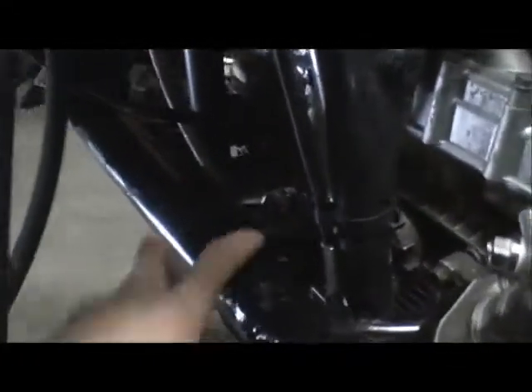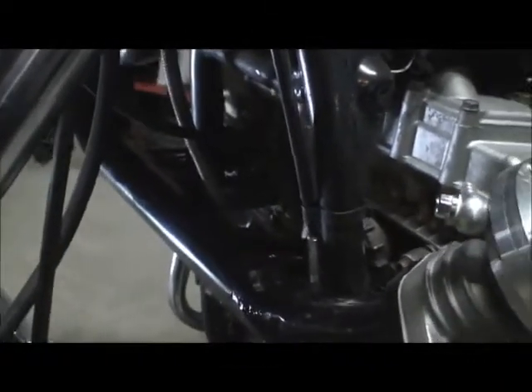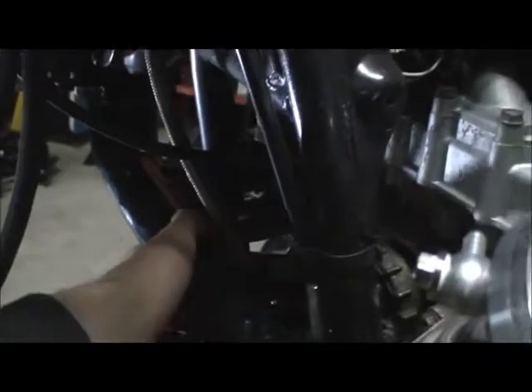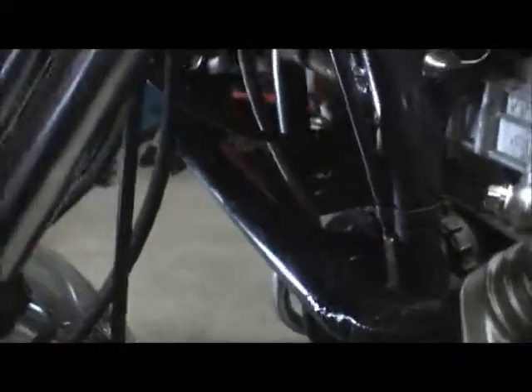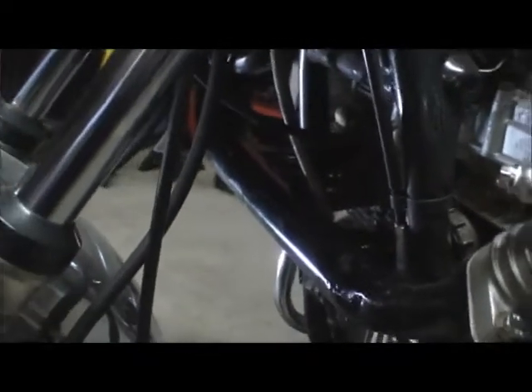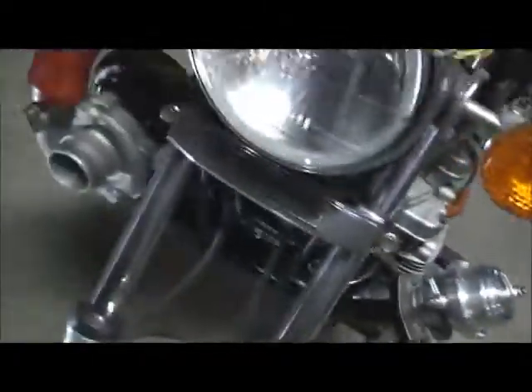What I wound up doing was changing all of these from running under — I bent them over and then welded everything together. Then I took a piece of two-and-a-quarter inch pipe, stuck it on there on its side, ran it down the band saw, and then continued a little bit up here for the wastegate.